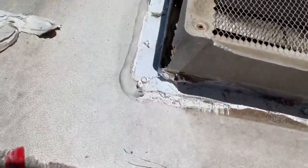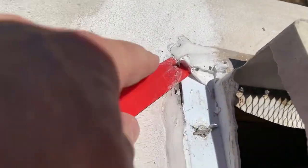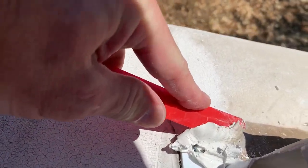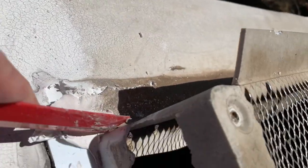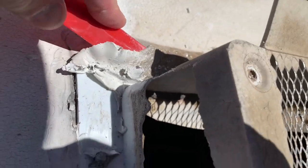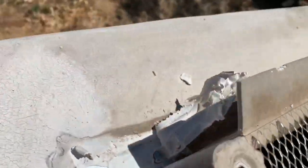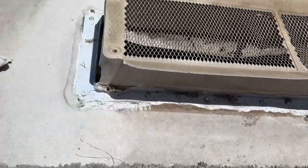When you're scraping the sealant off, I found it easiest to find the edge and just with your scraping tool follow that edge without grabbing the roof material. Go along one edge and then catch the edge up against the plastic roof vent, and then once you've done that you should be able to grab it and pull it back — just like that. This whole edge goes pretty quick.